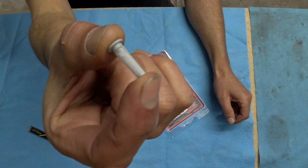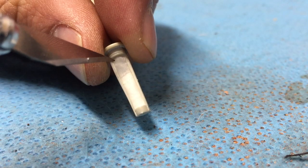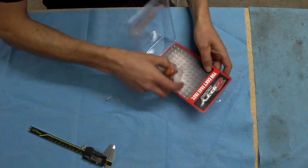You can see it's quite small, and as you may have seen in a previous video, they can get blocked up — contaminated fuel, whatever was in the tank, machining debris, etc. They get blocked up fairly easily; it doesn't take much to almost totally block these little filters. So why have I gone with this one? It's all about size.